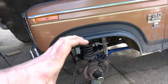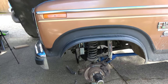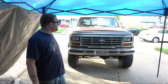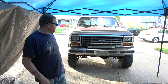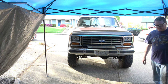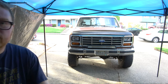If it does wobble I'll probably need to add some caster, but it's had the same caster since I put the axle in. The wobbling didn't start until that bushing wore out. Alright guys, I just took it for a little test spin and so far it's a big improvement. I haven't gone fast enough to see if it'll wobble — I don't think it will. I still have a little gear oil dribbling out from when I pulled the axle shafts, but anyway — let me show you the finished product.